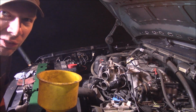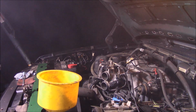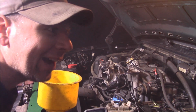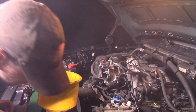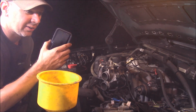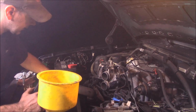The smoke from the exhaust, the new manifolds, and all the oil on everything. Ooh, that oil she's burning off there now. The thing's like a smoke show. I don't see any leaks so far. The oil pressure is good. The idle is just below the center of the normal. Thermostat hasn't opened up yet.